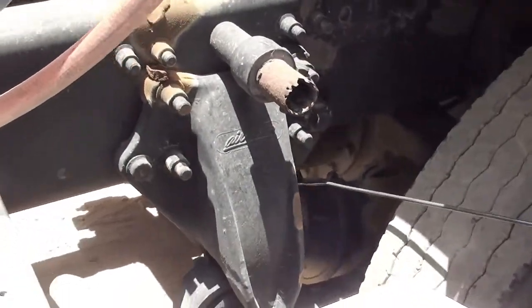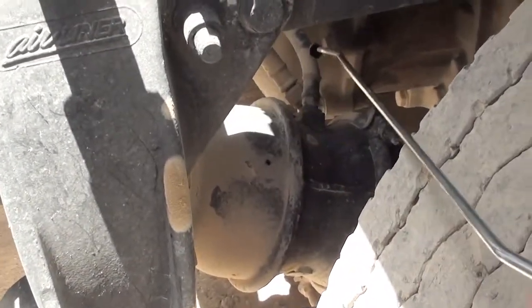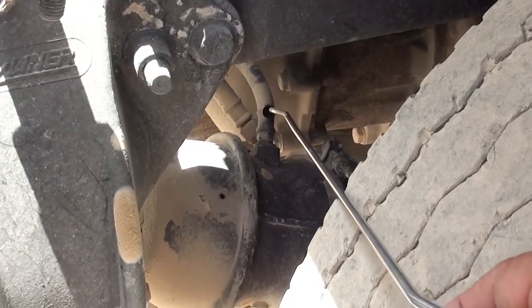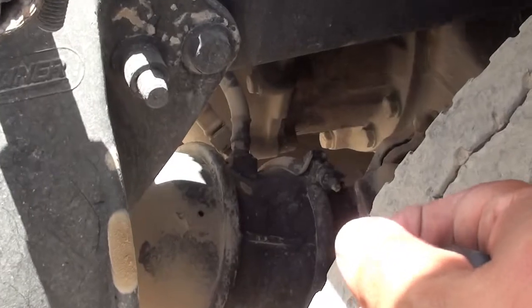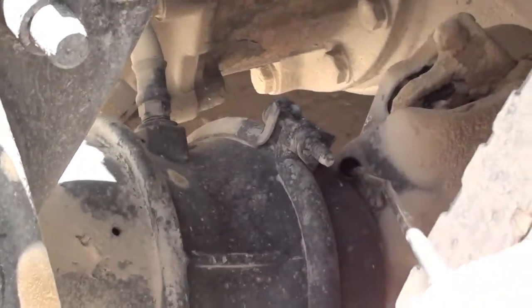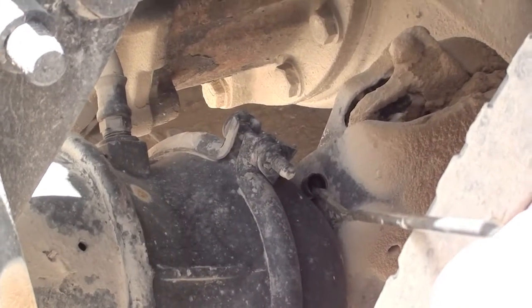Then from here, we're gonna go to the brake chamber. Brake chamber and brake chamber hose. Properly mounted, secure, not broken, or damaged, no missing hardware. Make sure there's no leaks. And then in the back, you got the push rod, cotter pin, and slack adjuster. Properly mounted, secure, not broken, damaged, no missing hardware. Push rod, no more than 1 inch play with the brake release.